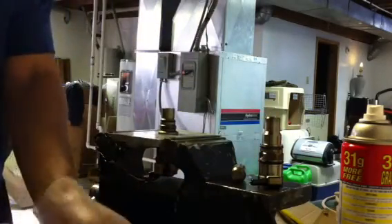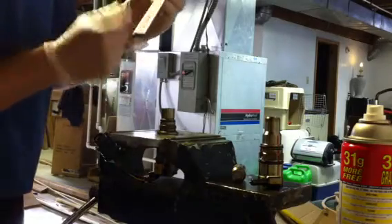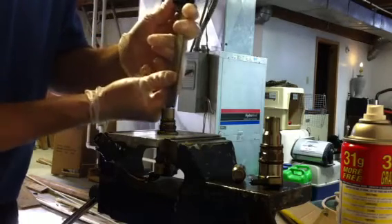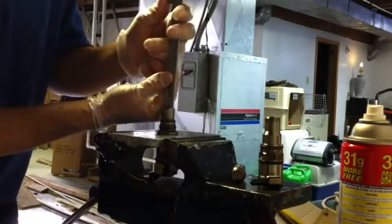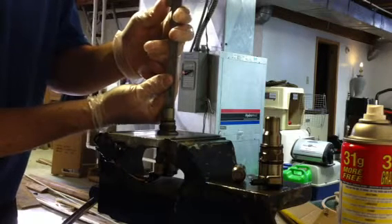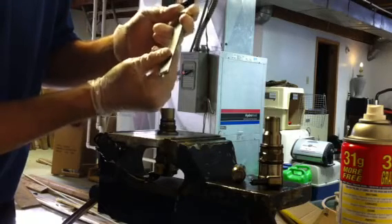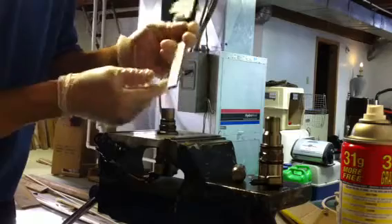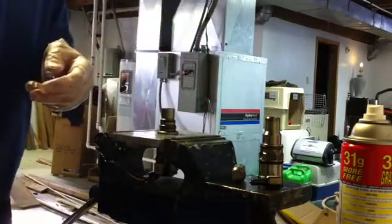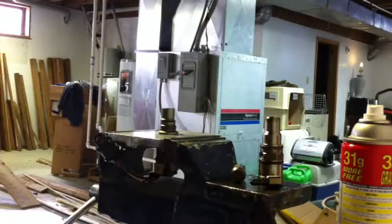Next, we're going to measure where the plunger sits in the bore. The reason we want to do that is if you want to make a change to the injector, you have to know where it sits at rest. In this particular case, it sits at 5.65 millimeters from the base, and that'll be a determining factor in where we actually start to make any modifications from.